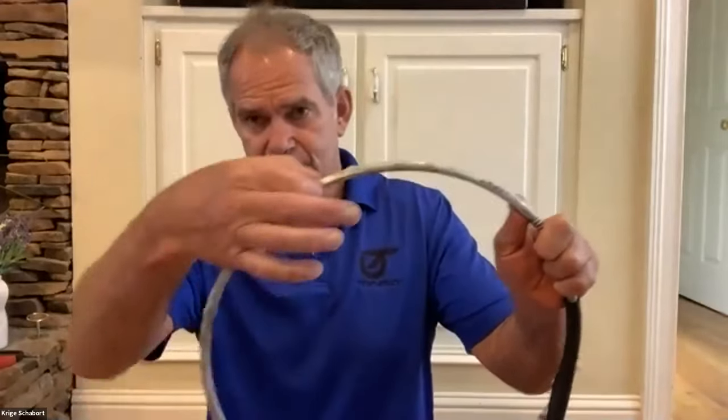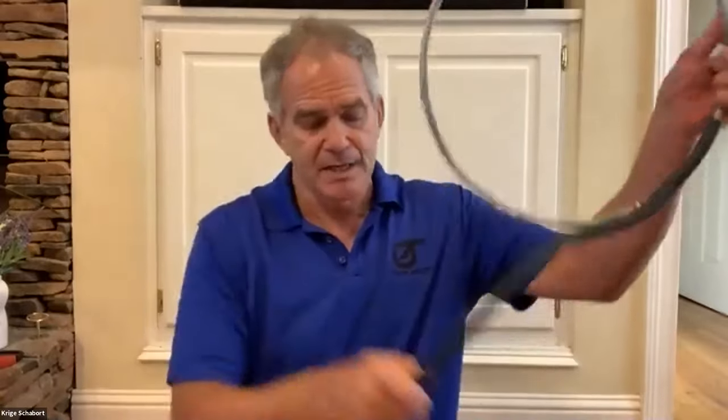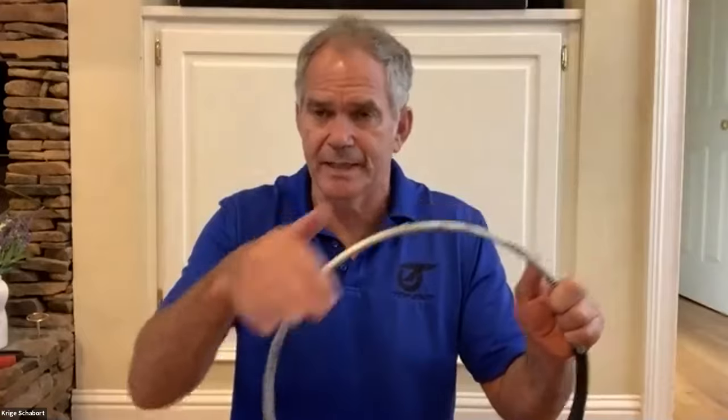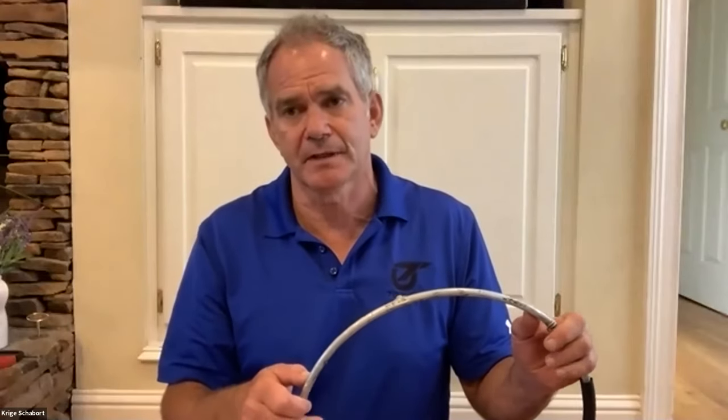Okay. Krieger, do you leave the double-sided tape on the hand rim and then apply the super glue and rubber? The double-sided tape will go on the outer edge, right? The small section, and the rubber will go over. I leave the double-sided tape on because that's going to prevent the rubber from turning. The only time I take it off is later on when the push rim is worn. Then I take the double-sided tape off, clean it with sandpaper, and put a new piece of double-sided tape on. Make sense?